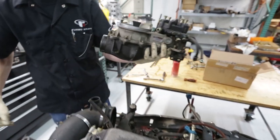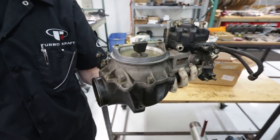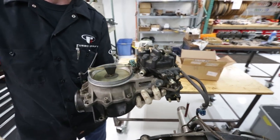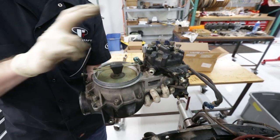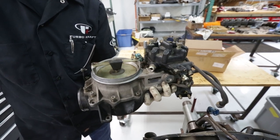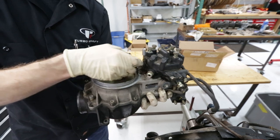And there it goes. The brains of CIS. That is one massive piece. Yeah. Solid iron on the fuel distributor. So these were the ones that flowed more, and so they were more desirable. This is the so-called Euro CIS, easy to tell by the black iron. The downside is long-term, now that our fuels have alcohol in them, which absorbs moisture. These are less desirable because they rust.